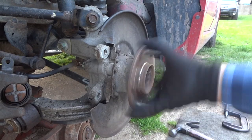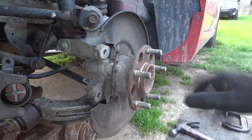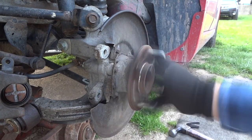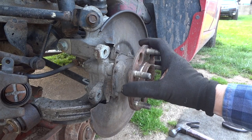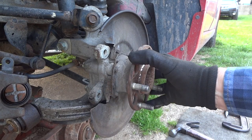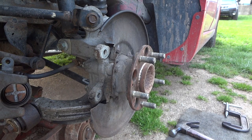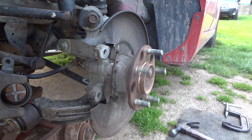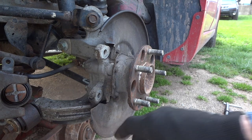Here's our bad one - hear that? So there's our noise. I can even feel it - oh yeah, I can feel it right there. You can see it's kind of not smooth. Good, so we've got our wheel bearing figured out - we know which one is bad.